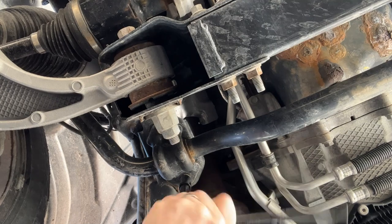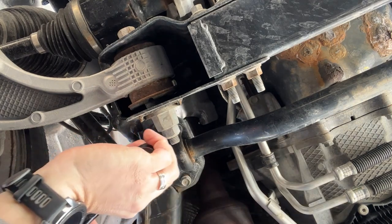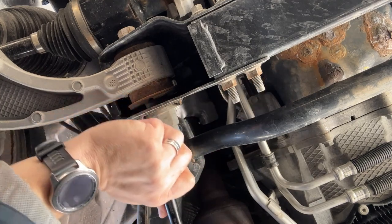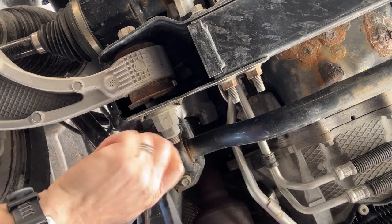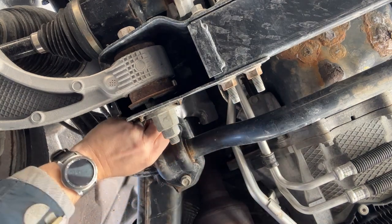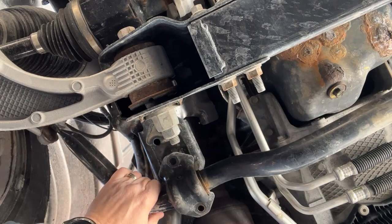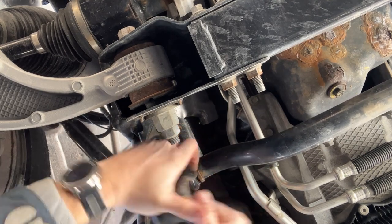What I'll do this time is leave it threaded in a bit and loosen the other side. I think I had some torque from the torsion bar moving backwards due to the sway bar link torque because I lifted the truck up some. As it pushes down this one is actually easier than the other side — but it depends where you are. If your truck is really rusty you're going to want to put penetrating oil. This is super easy coming off like nothing. I pulled down and out and you can pull this off.